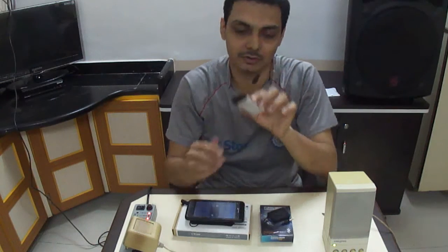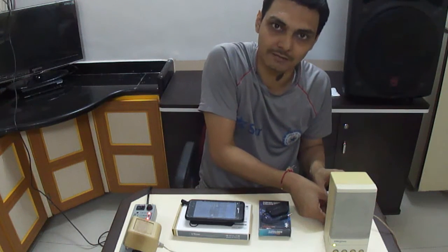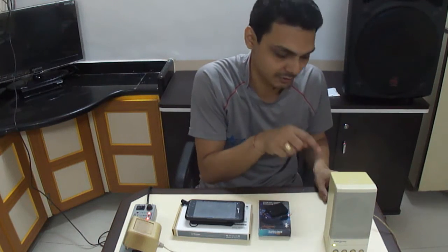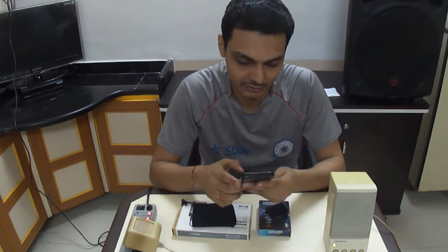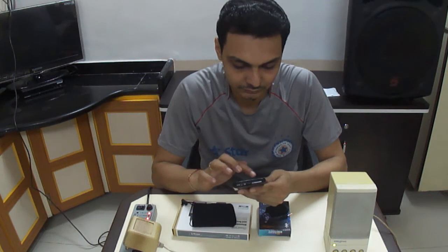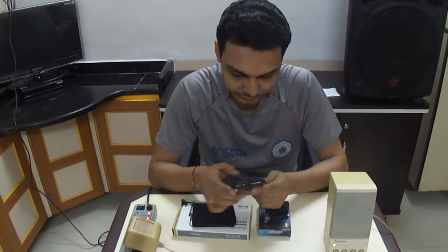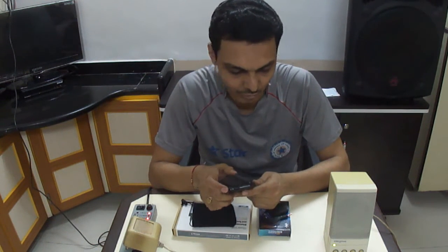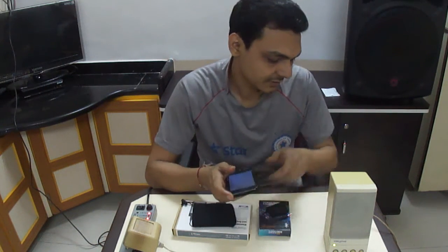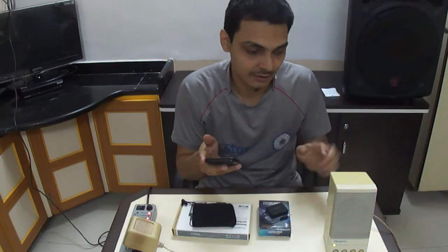It's very easy, guys — it's not difficult. Once you buy a Bluetooth receiver, you just connect the Bluetooth receiver with the input cord of your speaker. Every speaker and every music system has one input cord. Now I've connected the Bluetooth receiver to my speaker, and I'll search for the Bluetooth device on my phone. I'll turn on my Bluetooth, select the Bluetooth receiver I connected, and it's now connected. When I play music, it will directly get transmitted to my speakers via Bluetooth.